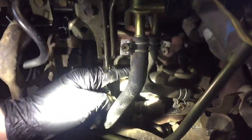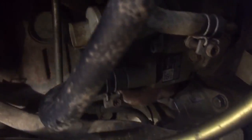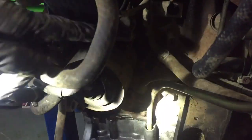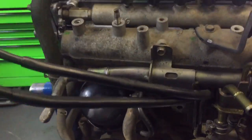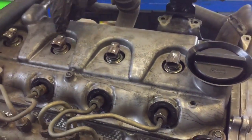Back at the fuel pump, the suction control valve is located there. That's basically the fuel temperature sensor. That there is your brake vacuum pump for your brakes. That is an oil pressure sensor. This is your oil cooler. This is your oil filter housing with your oil filter. This is your fuel pressure rail.